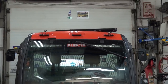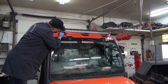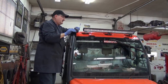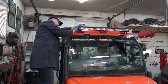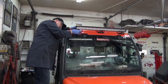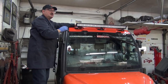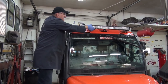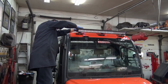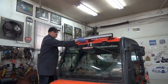I'm going to put this up and then we'll start to install the light bar itself. When you get your light bar placed on top and your brackets folded down, you're going to want to tighten up the main bar that goes along each one — the three of them. You do that by tipping it forward all the way, getting your 6mm Allen key, and going in through the back to tighten them in. Then of course you have your alignment done. With regards to aiming the light, just tilt it and tighten up your 10mm bolts underneath. Nice and solid, clean, very strong. I love the way they have their mounting system — it's very accommodating. You can put them wherever they're needed.